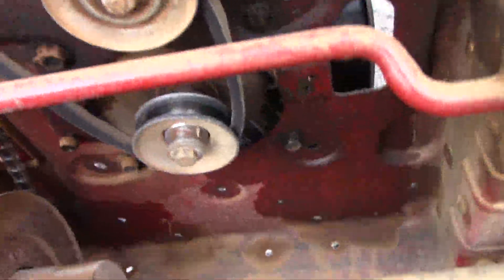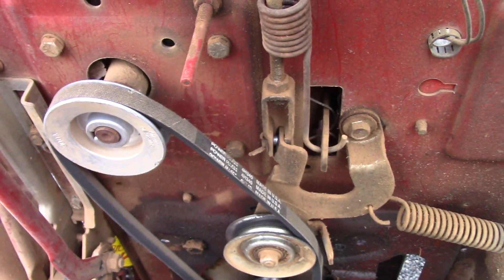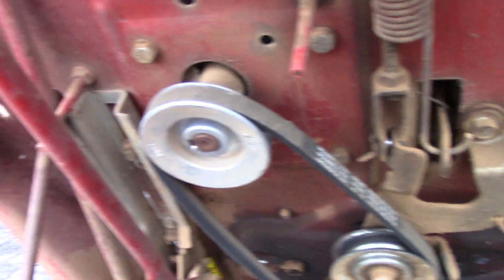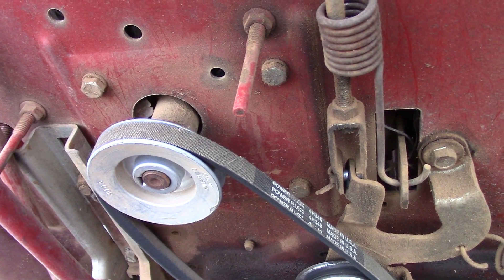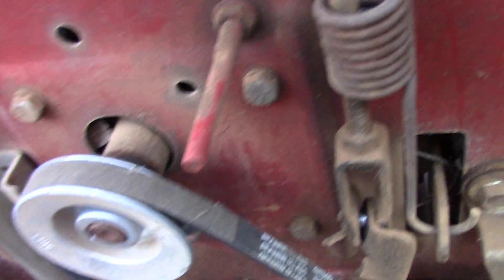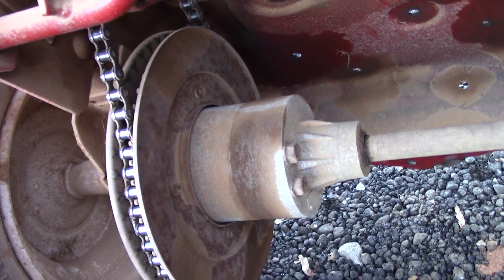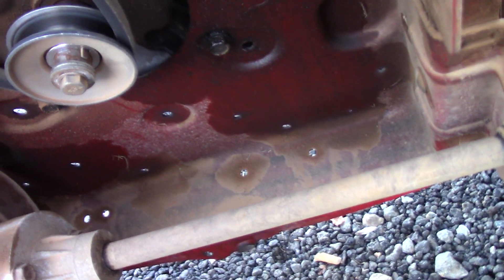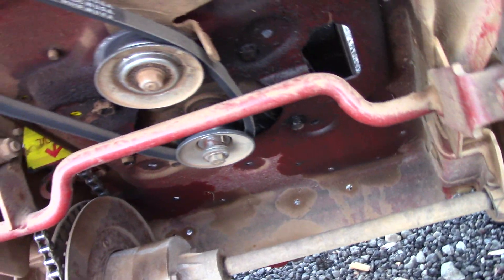This little thing doesn't weigh much. I changed the pulleys around — we went from a six-and-a-half inch pulley on the trans to a three-inch pulley on the transmission. It does a jack shaft thing because it actually goes from a belt drive into a gear system to a chain drive on the axle. The mower had a two-inch pulley; we went up to a three-inch, so it's three-inch and three-inch — like a one-to-one ratio type of deal.